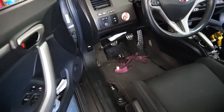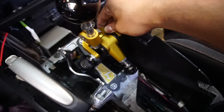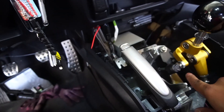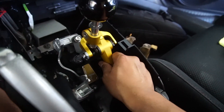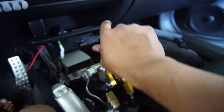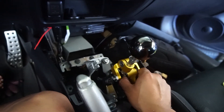We're golden. Let this thing warm up, fill up with air, and then I'll fill up the rear manually just so I can have air in the system and sit properly. I also need to tighten these bolts with Loctite because otherwise it's going to have this play — like you can see that movement — that's not good. We got it all buttoned up. I used thread locker in there so I know it's not going to come loose anytime soon.